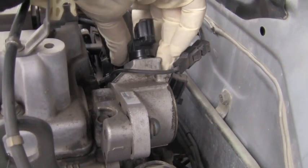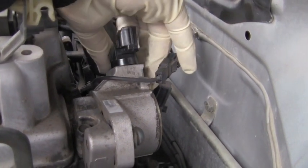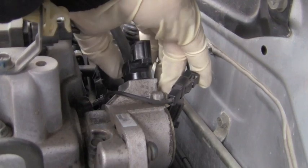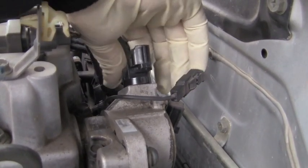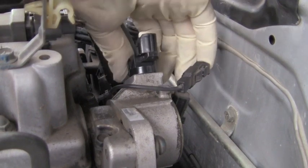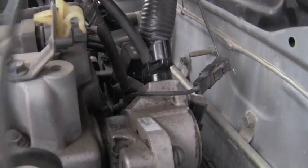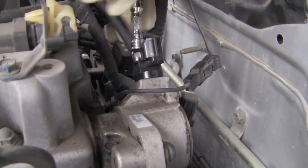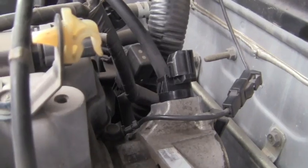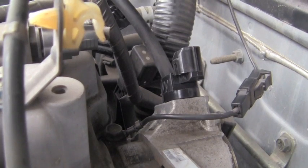When you do this there's really no adjustment to it. You slide it down in place — it's got an index to keep it in the right place — and you put your 10 millimeter bolt back. The body of it will only let it go down so far, and it's simply a magnetic pickup. That 10 millimeter bolt is holding it down and the body is plastic, so don't over tighten it or you'll crack the plastic. Just make it real good and snug.